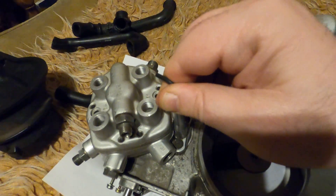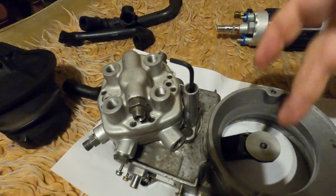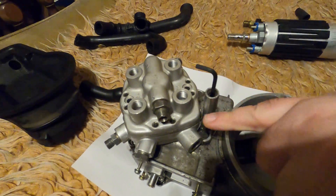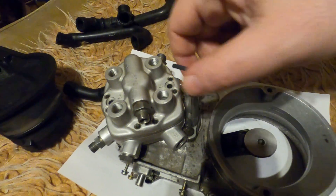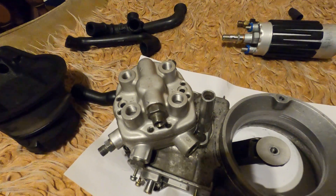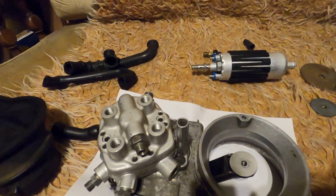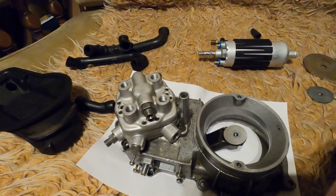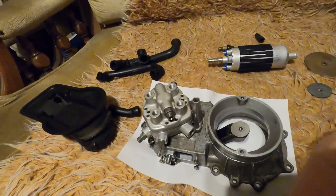From that position where the fuel started flowing, you then turn this Allen key half a turn counterclockwise. Under this condition, every car must start — no matter which one, and no matter how the mixture is set.